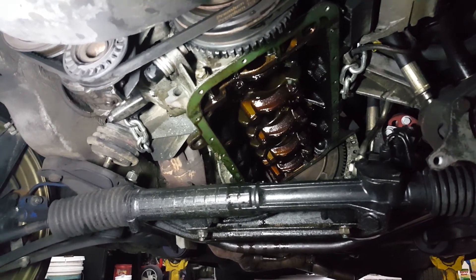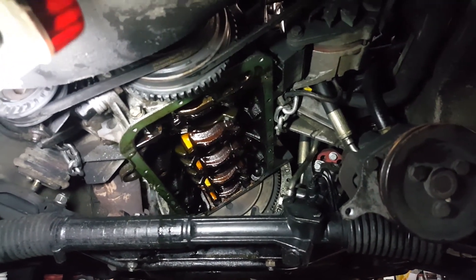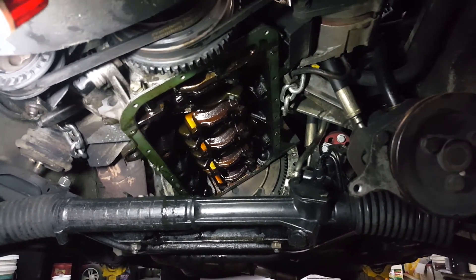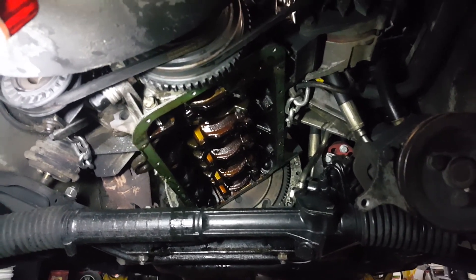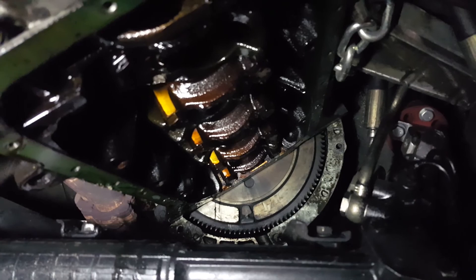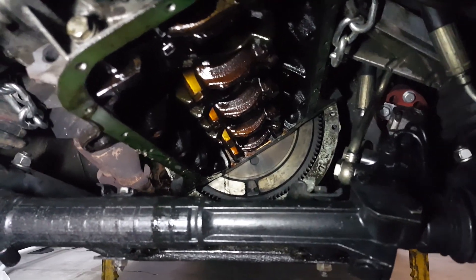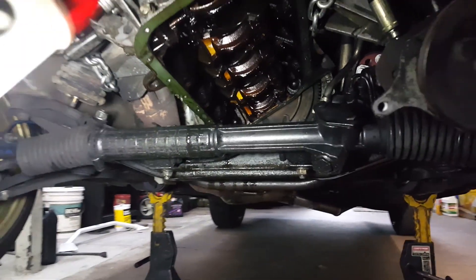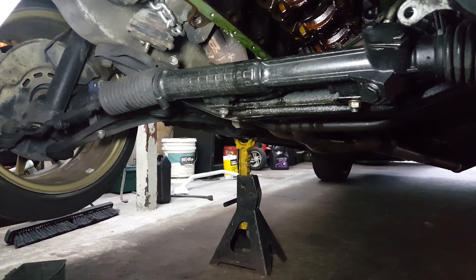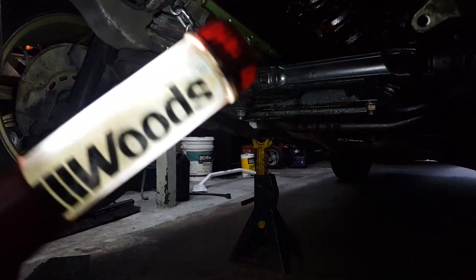So that when you apply more throttle and power to the engine, it responds a lot better to the torque. There goes also the dual mass flywheel — that heavy son of a gun. I was going to replace that with the M20 flywheel I picked up in my first video from Clearwater, but since I'm deciding to go six speed, I will be swapping that out for a single mass flywheel for the E46. I'm trying to figure out whether or not I'm going to do that while I'm down here in South Florida for winter break, because my clutch is actually starting to wear out quite a bit, so I want to start getting that set up properly.